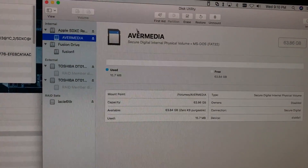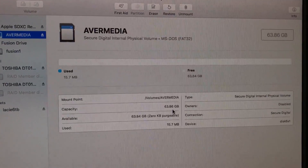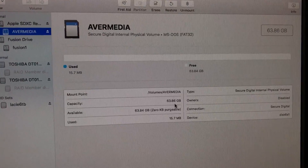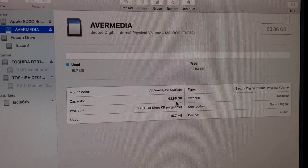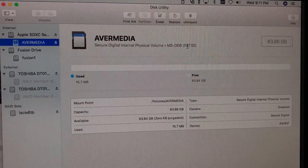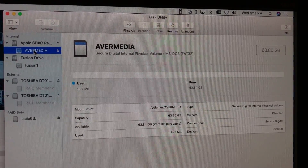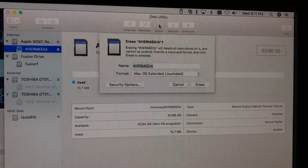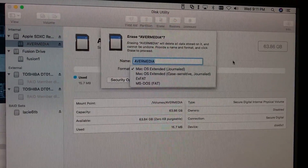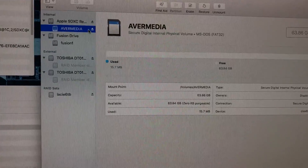The other thing about the SD card — here's a 64 gig card that I'm using. The 64 gig is going to record probably a couple of hours, a really long time. It'll support up to 120 gig cards. But either way, for this to work you have to format it as FAT32. If you don't know how to do that, Google how to format SD cards FAT32. On a Mac, you select your media and do Erase, making sure you choose FAT, and it'll format it as FAT32. Then you simply take that card and put it in the back, and then you're done.